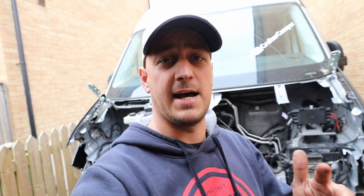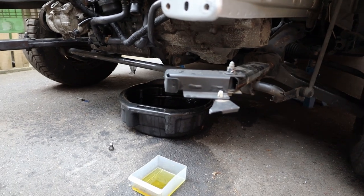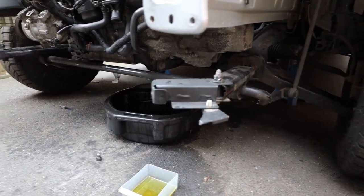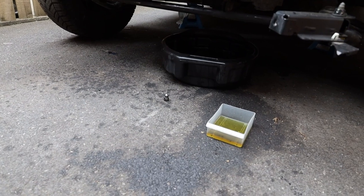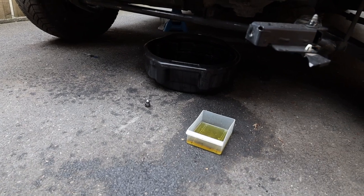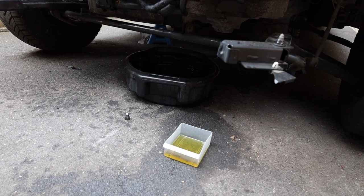There were some fuel hoses here which you can see kind of hanging around. I've just whizzed through that - I'll put a detailed explanation in the second part of the video. I know some of you just like to watch it, see it being removed, have a look at it out. I've actually filmed every connection being disconnected. I've also removed both drive shafts from the gearbox because obviously it wouldn't come out without those being removed. I've just drained any oil just to make sure it didn't weigh as much - I think it takes about seven litres of oil so it's quite an extra bit of weight.